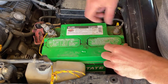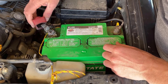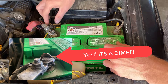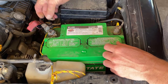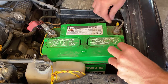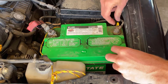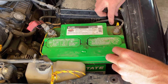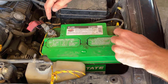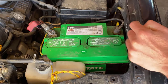If you look at the two cables installed, this positive one is very worn — there's something jammed into here and it just needs to be replaced and cleaned up. A lot of this tape is covering up frayed wires, and that goes for the other side too, our negative side. There's a lot of cable showing through, a lot of old kinks — everything's just old. For 20 bucks I bought two new cables to replace these, and I'll show you how to do that right now.